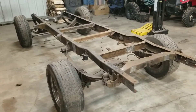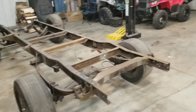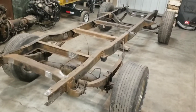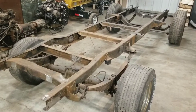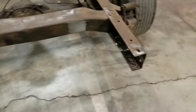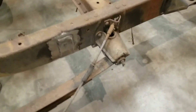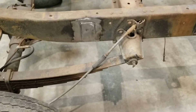I've been hammering away on the frame for the 55 GMC pretty hard for like the last two weeks. I got everything stripped off of it other than the axles and leaf springs. Had a couple spots I had to repair - both frame ends. The bottoms were pretty torn up, they needed repaired. Took the helper relief stops off and that left some big holes, so instead of just welding up the holes I made a nice little patch.